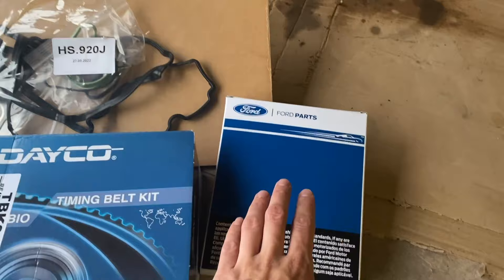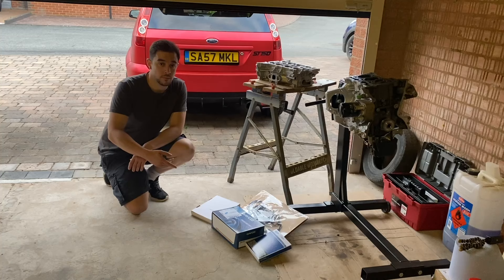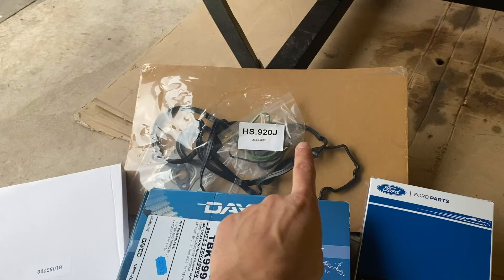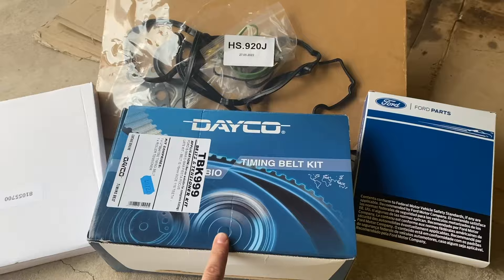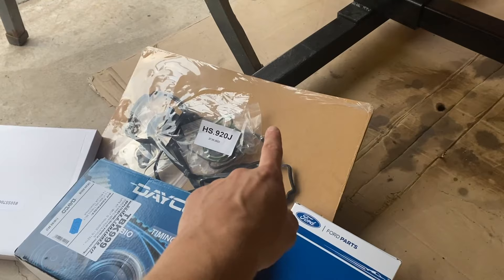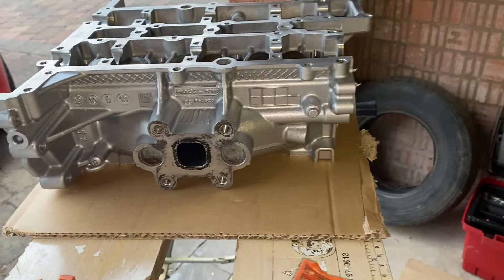I've got a new crankshaft oil seal and new head bolts. I managed to get the timing belt and the head gasket all in one kit, with a few other bits bought separately — I'll leave links in the description. There were direct OE replacements and also some cheaper options, which is what I went for. Dayco make the OE timing belts for these engines, so that wasn't a concern. I'm not 100% sure what brand this head gasket is, but it's certainly going to be a vast improvement over what we had. I've also given the cylinder head a nice coat of engine enamel that we used on the rest of the engine block.